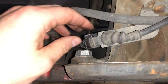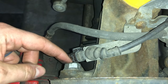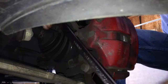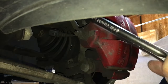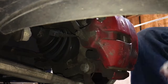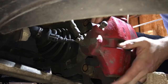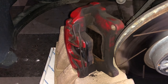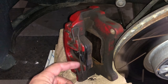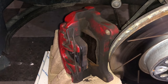The very first thing we need to do is remove this brake pad sensor — it needs to be removed so I can get to this bolt. Pretty simple, you just press on the back pin and it'll slide right off. Here we are — we got the caliper off the disc, just the two bolts that hold it on. Now we need to remove the retaining bracket and both calipers so that when we're cleaning and painting we're simply working on just the caliper itself.